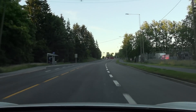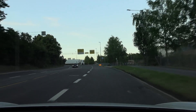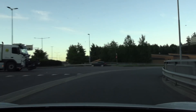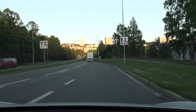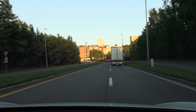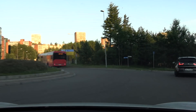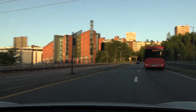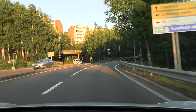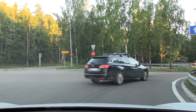We are now driving, and you probably hear that my voice is slightly different than before. That's because I have switched off the high pass filter — or low cut filter — which cuts off the lowest frequencies. Since I shoot video a lot when I'm inside the car, by default I always put it on with the low cut filter. So you will normally hear less of this rumbling, but I switched it off now so you can hear the rumbling. The camera is also doing auto gain, so if I stop talking the gain will adjust up and you'll hear more background noise, then when I start speaking it adjusts back down.